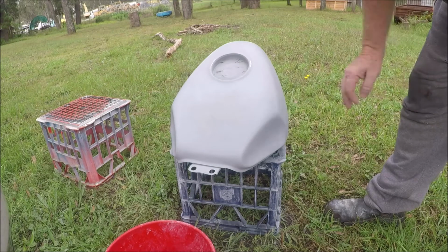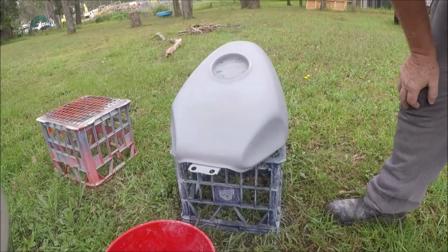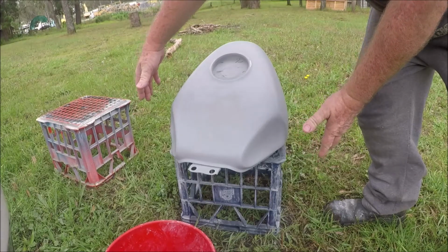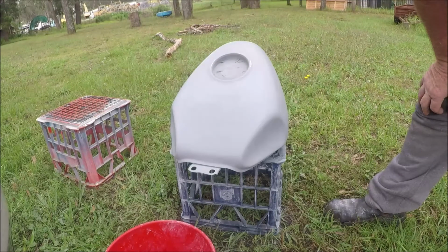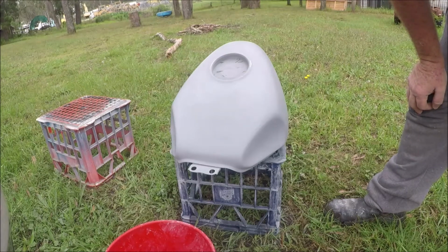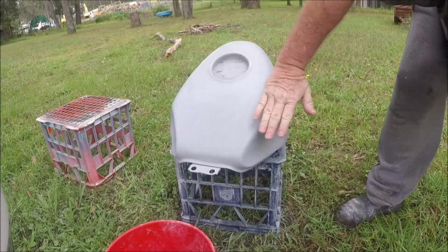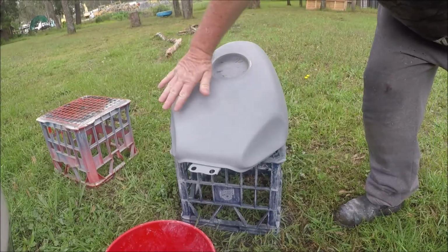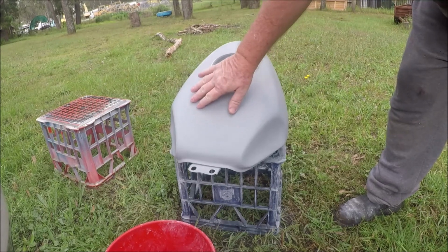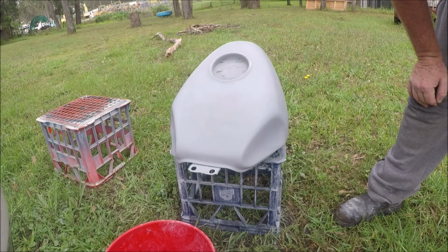With a car, if I ever paint a car, I tend to use the long board, because cars have big flat panels, so you can use a long board, which is like a sanding board about that by about that, and you can really flatten those things out. With a tank, not so much. Really, you just want to get rid of your imperfections and make sure that when people look across the surfaces from an angle, they don't see ripples. So that's where the sanding block tends to come into play, and you can actually see that it's knocked the top off that putty there to some degree. But yeah, I'm satisfied with this.